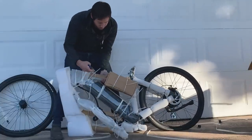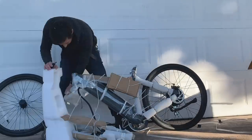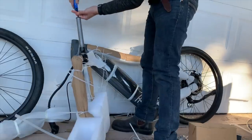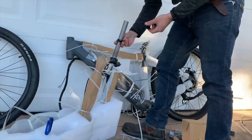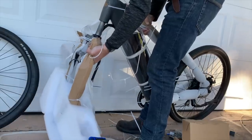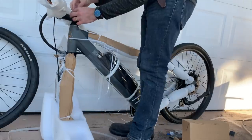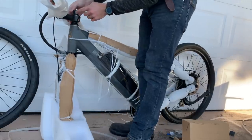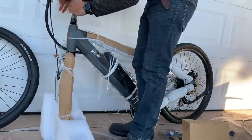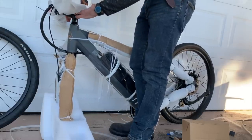In this case the fork is also uninstalled, so I'm going to have to cut away the fork as well. After the fork is free and I've removed the foam, I'll unscrew the cap at the top and slide off the top cap, the dust cover, and the bearing race. Now I can slide the fork stem through the headset and out the top, where I'll then replace the bearing race, the dust cover, and any other various little ring pieces. From there you can put the handlebars on the stem, followed by the spacers, or you can slide on the spacers first if you want to bring the handlebars up higher. Those spacers can be used for adjusting the height of the handlebars however you'd like it to fit your riding style and your body size.